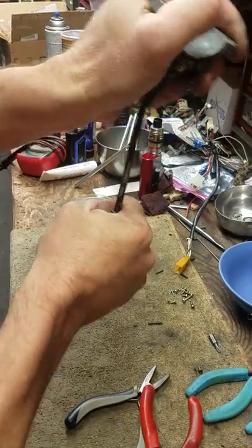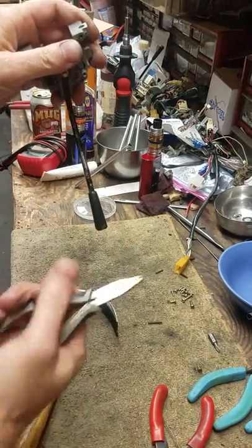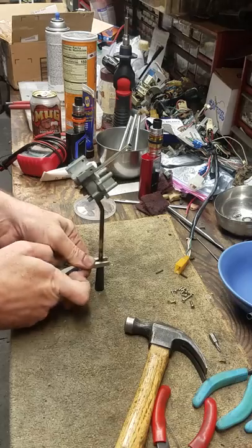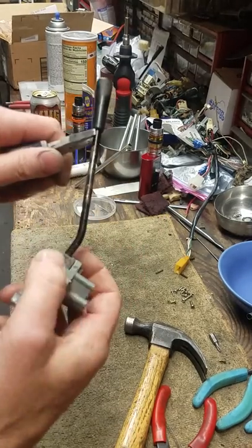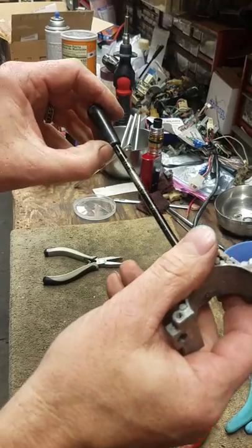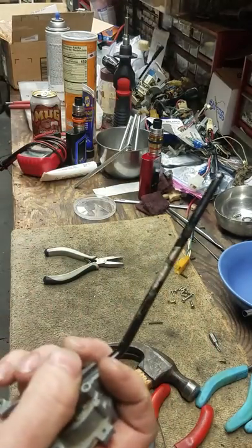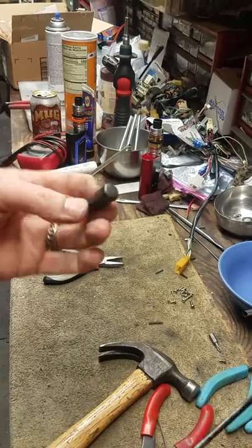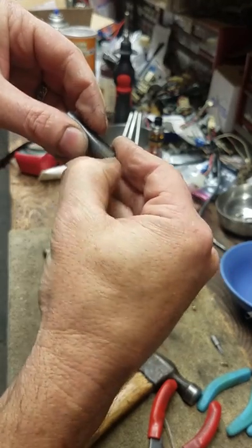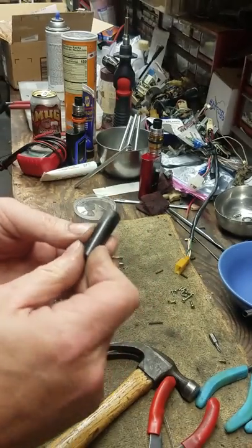While this is still assembled, we're going to try to get this handle off because you don't want to try to do it when it's just this rod. Normally you can grab it and give it a spin. If that doesn't work, take your needle nose duckbill pliers, put that on there — carefully if you don't want to scratch the paint. Break that loose because it glues itself after a while. It pops off that easy. We're going to clean this later with rubbing alcohol — you can see the goo from people's fingers.